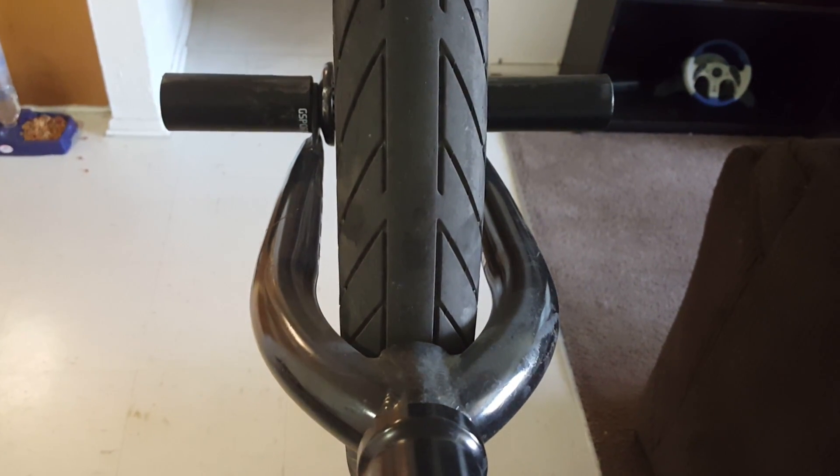The best tip I got from a friend: every time you lace a wheel, ride it for about a week or two so your spokes can stretch. It's already been about a week since I had this laced up. The reason to re-true after the spokes are stretched is that the chances of having to re-true it again are really, really slim.